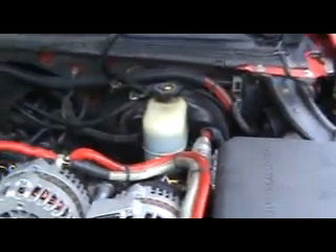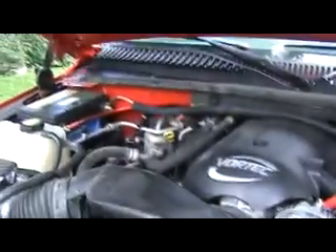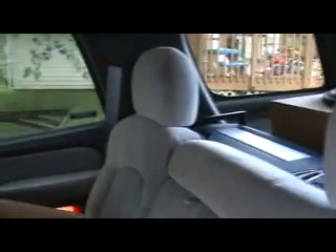I've got seven Kinetic 2400s, an 1800 up front, and my stock battery. Showed all this stuff once before but that was like last year. I'm going to be doing some Term Lab numbers here shortly. I've got another port to try - a little longer - to see if I can tune it down just a bit. I'm real happy with it right where it's at, but I'm going to have it all apart putting some fiberglass in it, so I might as well do it now.